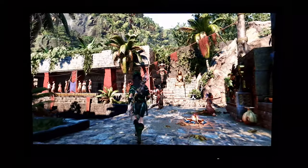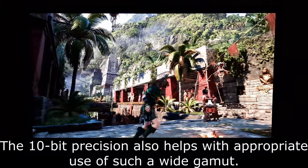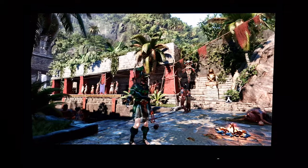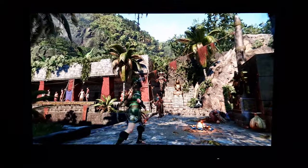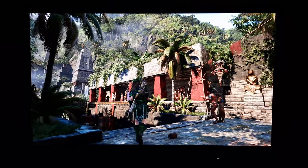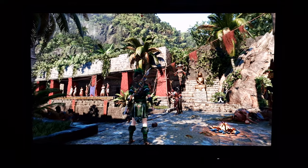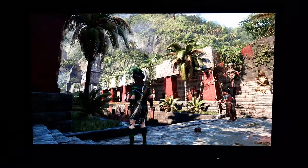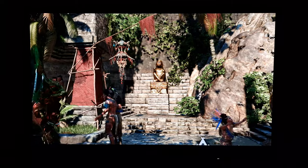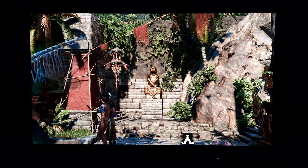So under HDR now, I'm going to really talk about color reproduction under HDR, because that's another important aspect of HDR. The monitor's generous color gamut is put to excellent use here. The developers are not targeting sRGB anymore. They're targeting extended color spaces like DCI-P3 and ultimately Rec. 2020. This monitor does well there. I know it doesn't fully cover Rec. 2020, so there's extra vibrancy potential for HDR content than what this delivers, but honestly, you're not going to look at things and think it looks anything but vibrant. It really does give excellent richness, excellent vibrancy, and it doesn't have a white OLED subpixel. It's not a WOLED design or WRGB OLED design, so that means it can maintain strong saturation at high brightness levels as well, so it doesn't dilute it in that respect.